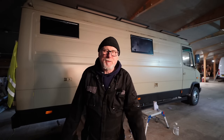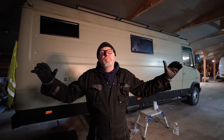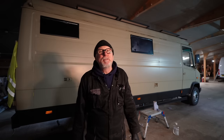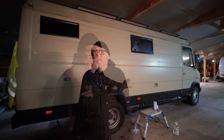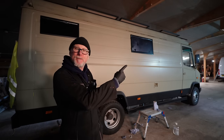Well there you go guys — it just goes to prove it's always a good idea to use the right sealant. Masterbond is perfectly good for huge glass panels where it's got plenty of room to expand and ooze out where it won't end up on the outside making a nasty mess. But when you're fitting windows like this where you've only got a tiny little rim, use something like Tiger Seal that's easy to wipe off. Whatever sealant you choose, try squeezing a little bit on the inside of your door panel first to see how easy it is to wipe off your paintwork with white spirits. Hopefully you found this video mildly entertaining and slightly informative — thanks for watching, tara for now!